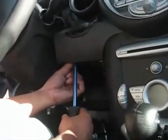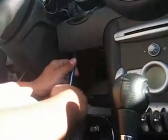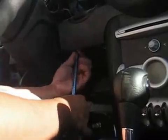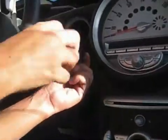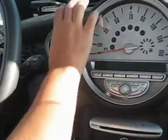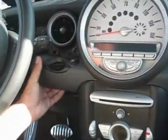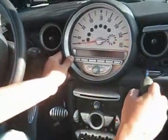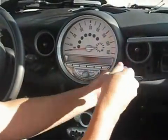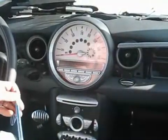You should find three screws on this little portion right here, which is the key sensor reading portion. All you're going to do is take off these two screws and this screw up here. Before pulling anything off, go ahead and pull this little plastic trim that goes around the odometer off. I like to go from left to right to catch all the screws on the first pass, then pull this off and catch all the screws on the second pass. They're all T20 screws.